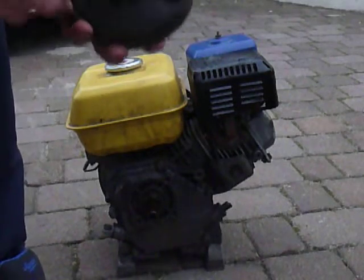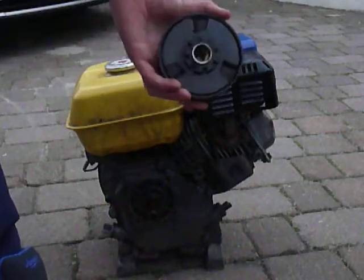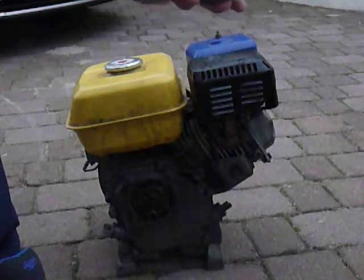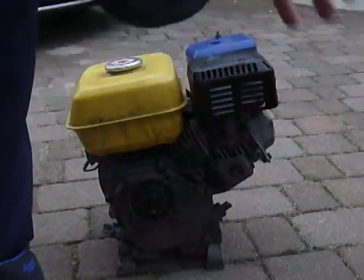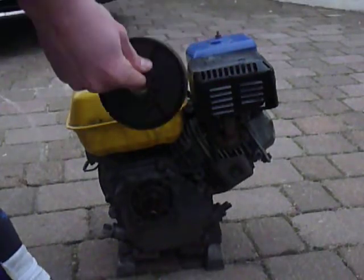So I'll go over that again. Inside this, the revs go over a certain RPM, shoes expand inside this bit, open up, latch onto the outside bit here, which is attached to that, and then that drives the go-cart.